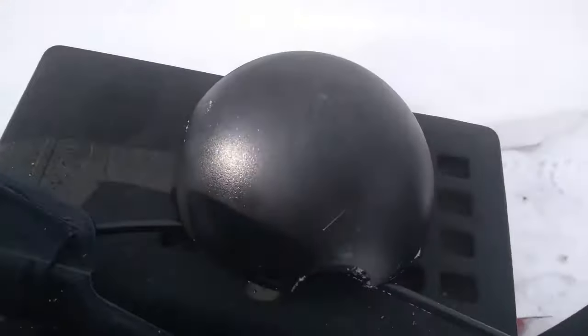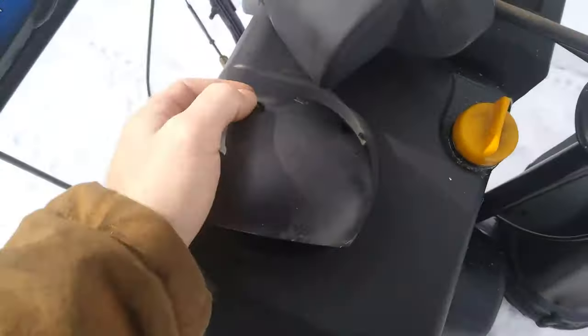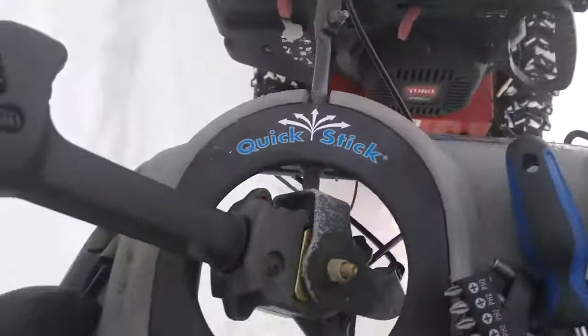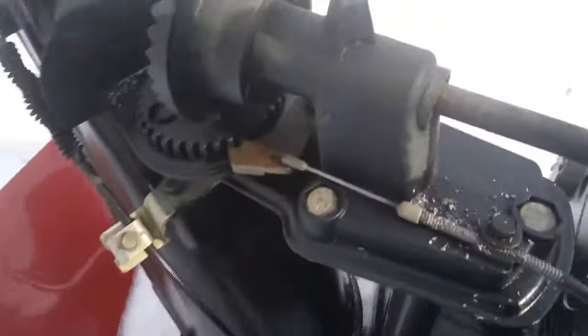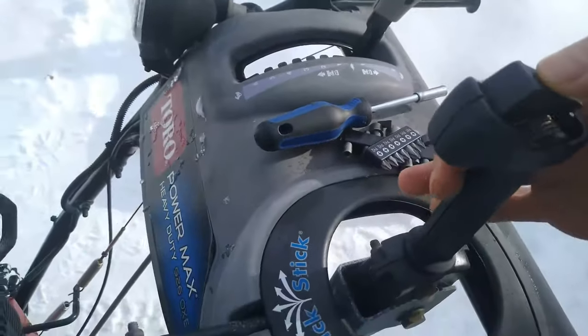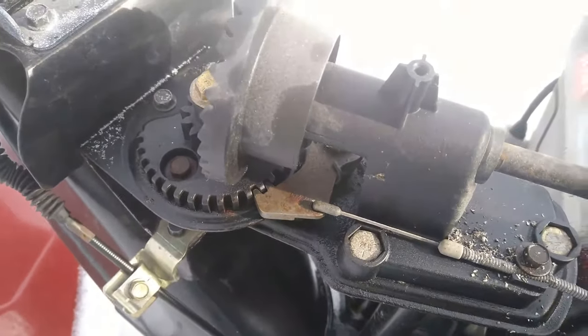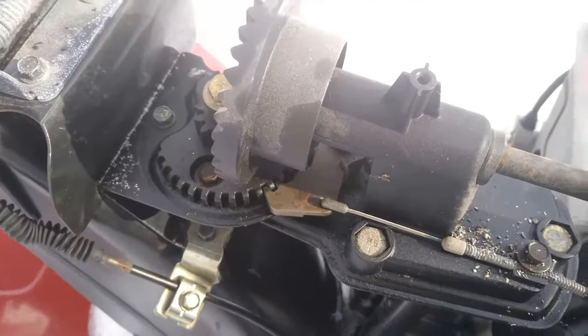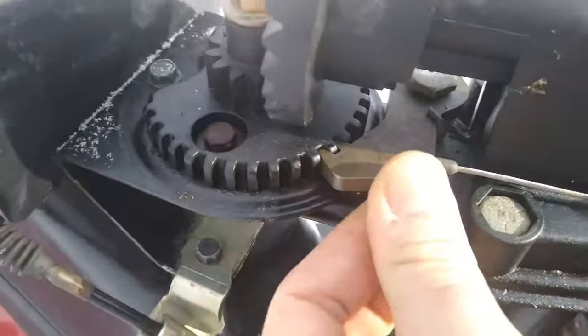This is just two halves — here's one half and there's the other half. The screws do look a bit rusty, so I'd suggest putting some Never-Seez on them so you don't have an issue taking them out later. Now you can really get in here and see how the mechanism works. When you press this button — the blue part — it comes down through this cable and latches. This part seems to move really well, so it's not the issue — it's either the cable sticking or the other locking mechanism.